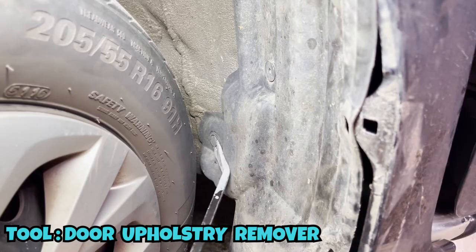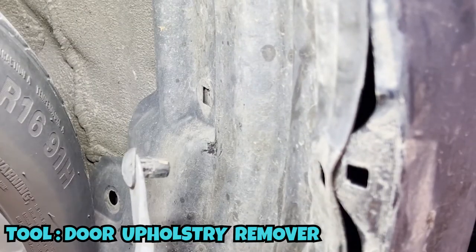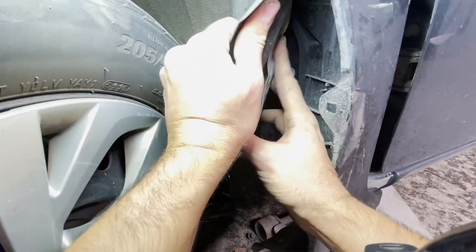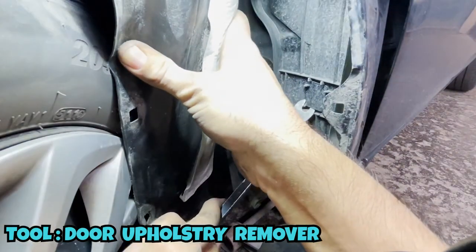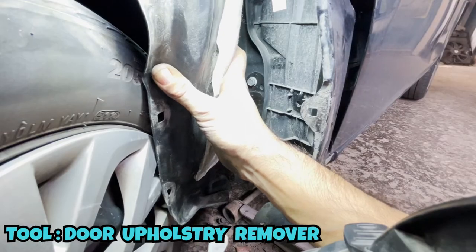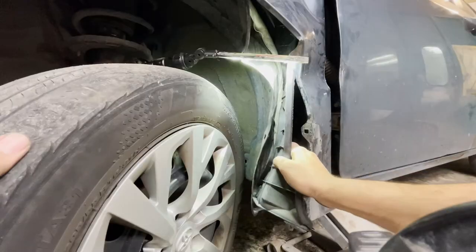To figure out what's holding it, we take out the end clip of the fender liner — another mudguard-type clip. The inside cover needs to come out, and we have to take out that square-shaped clip for that. Once done, we pull the cover right and left until it's completely taken out.